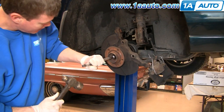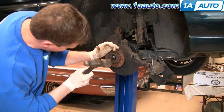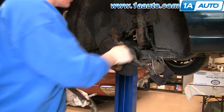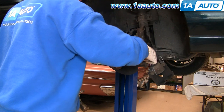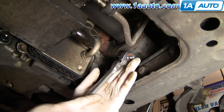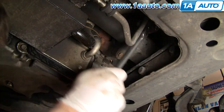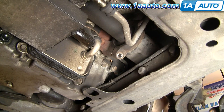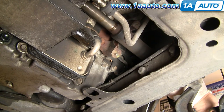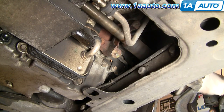Once that strut's unhooked, just take an extension and your axle should drive out pretty easily. You can see the axle is free. Now looking up from underneath where the axle goes into the transmission — there are two bolts on a cap; they're 12mm, so we're going to remove those. Then you can reach in and pull your axle and it slides out. Just be careful that you don't hit any ABS wiring or your brake line harnesses as it's coming out.